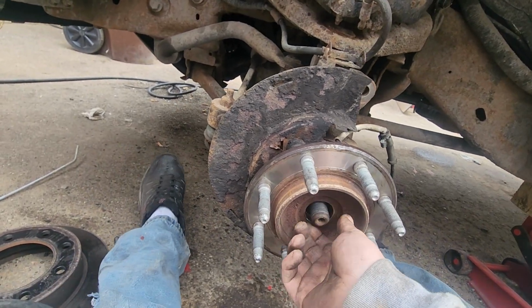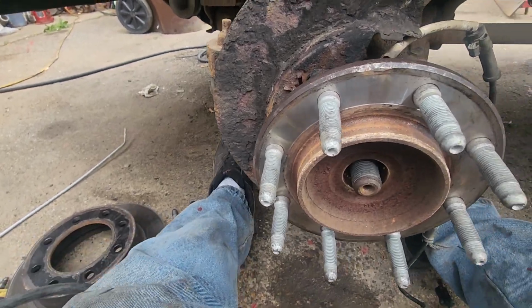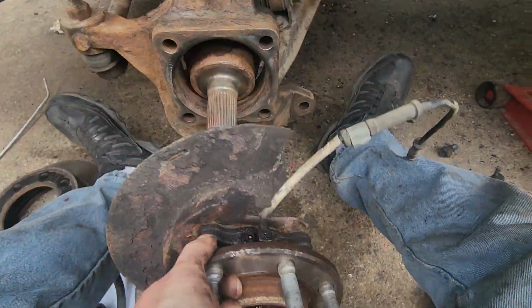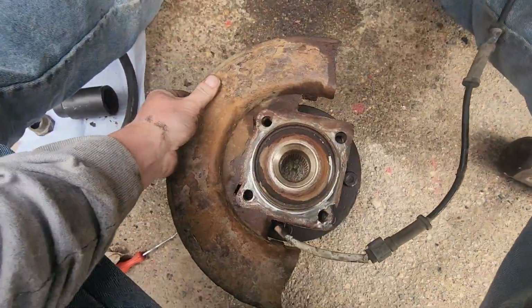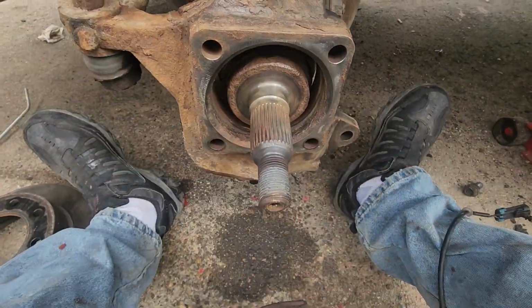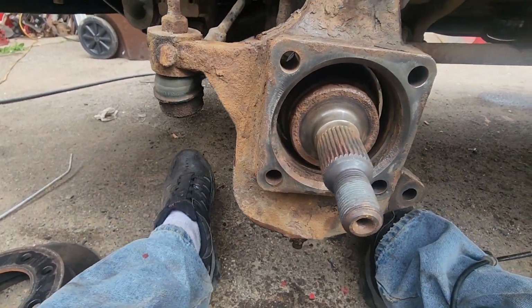Sorry, I forgot about that. You got to take off your axle nut, the big nut and the washer, which is a 35. So, you got this all unplugged, you got the axle nut off. You beat this off until you get it down. Then you got to get your backing plate off, unless you're going to use a different one. Then, I take a minute and clean it up. A garage don't do it because the garage don't care because it costs money to take time out.